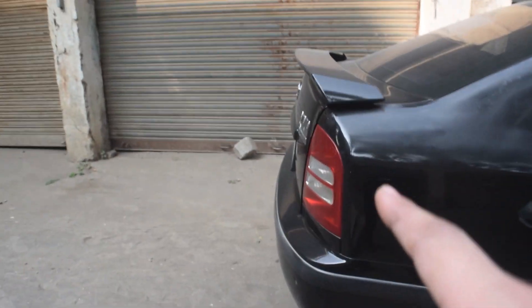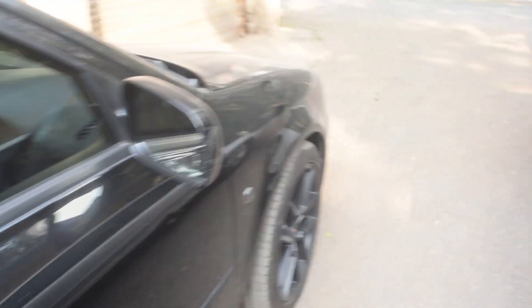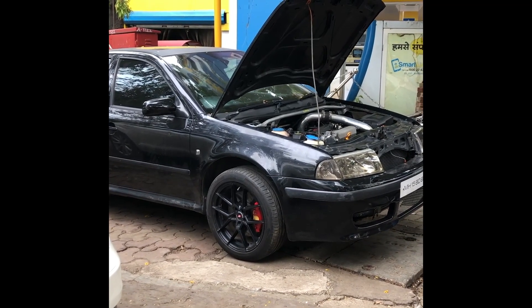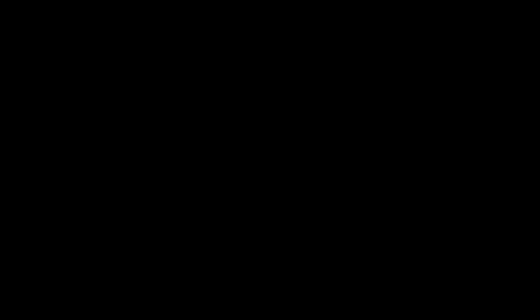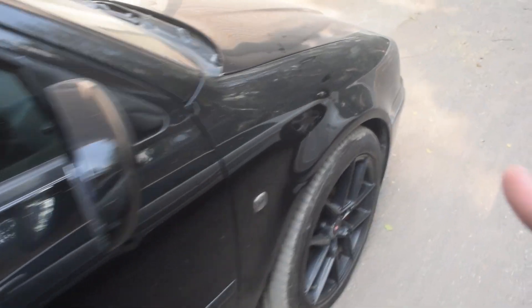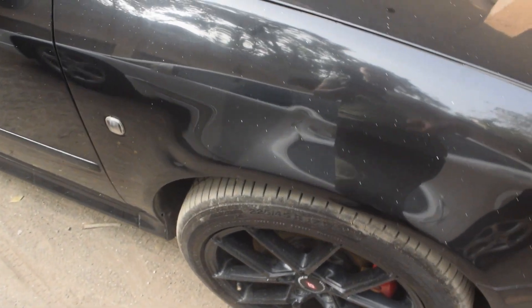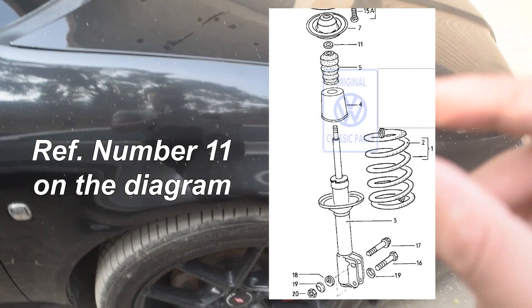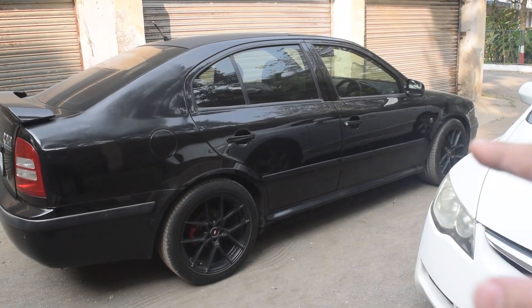So that's the back side - two mods I have not recorded. The most important one I feel bad about not making a video on. The car is now on Cobra lowering springs - 35mm front, 35mm rear - with custom struts that are a little stiffer than the stock VRS struts. There's also a metal spacer of about an inch removed from the front, so the car now sits more even. In a stock Mark 1 VRS it sits lower on the rear; now it sits flush on the front and equal on the rear.